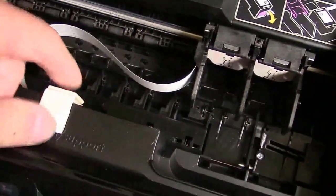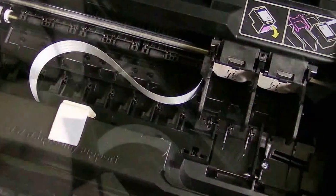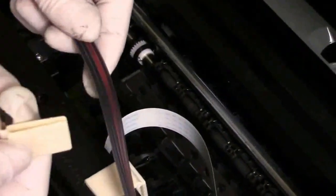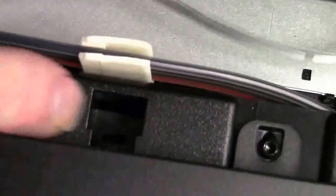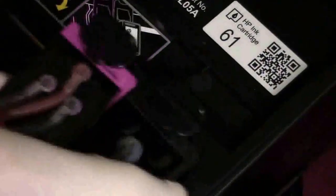Now here's a little trick: put the hose on first, then stick the bracket to the printer — makes it easier, otherwise you have to try to bring the hose up into the bracket. Some brackets, like on the OfficeJet 5740, come from the bottom up; on the Envy and others, they mostly go from the top down. The instructions will show you where to place it, and then you'll be able to install the cartridges.